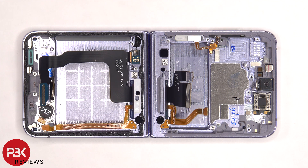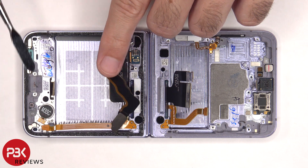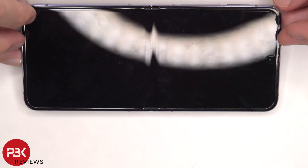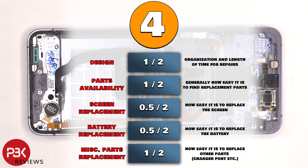When it comes to replacing the inner foldable screen, it's pretty much the same as the Z Flip 3. If you want to see that in more detail, you can watch the video I did on the Z Flip 3. I don't want to risk prying this working screen off since there's a high chance of damaging it. The folding screen cable is located here — basically all you have to do is pry off this plastic border, then heat up the foldable screen and pry it off the frame. For the repairability score on this phone, I give it a 4 out of 10.